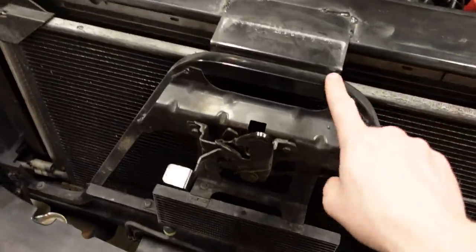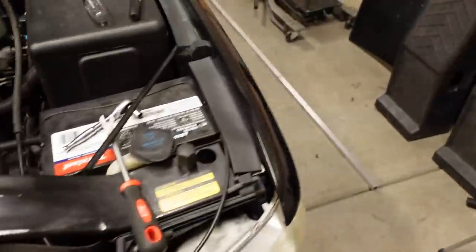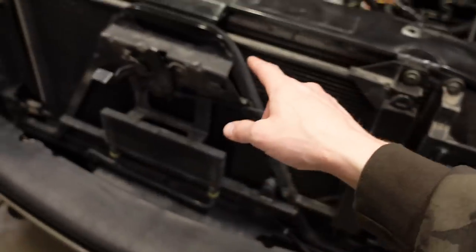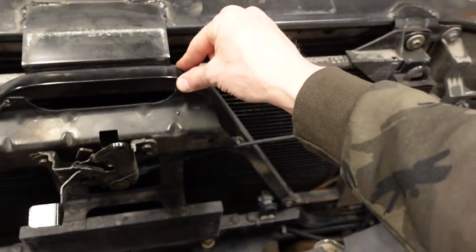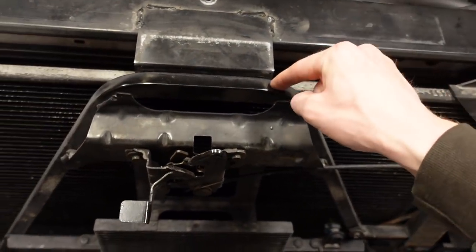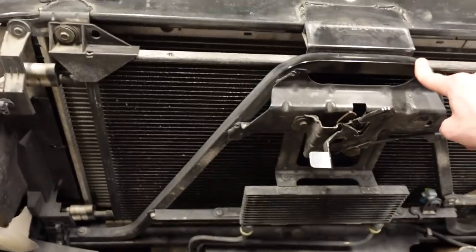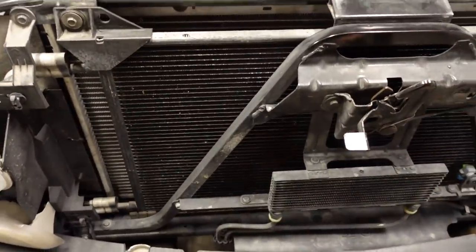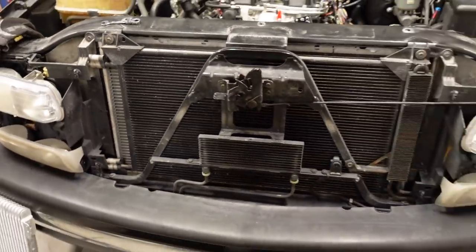This is made from aluminum, so that's a bit of a challenge, but I went down to the local metal mart and picked up some 1-inch square aluminum, 125 wall. That's just a little bit bigger than this, which is like 7/8 of an inch, but I could not find any 7/8 inch square stock aluminum. So it'll be a little bit larger, but we'll weld this all together and we'll have a really awesome bracket by the time we're done.